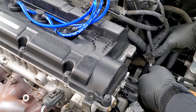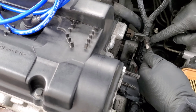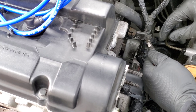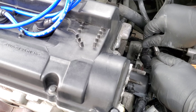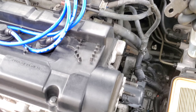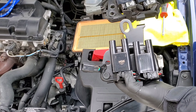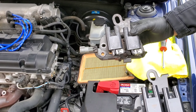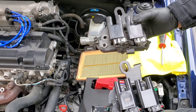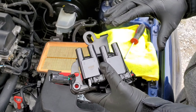This is the final step to removing the old ignition coil. Take this connector off of the ignition coil and now you can pull the old one out. This is the original and it looks really bad. This is good to replace every hundred thousand miles, so I do recommend you do that. Before you put your new ignition coil in, make sure you clean this area. You don't have to do a spectacular job because it can be pretty hard, but clean it good enough.